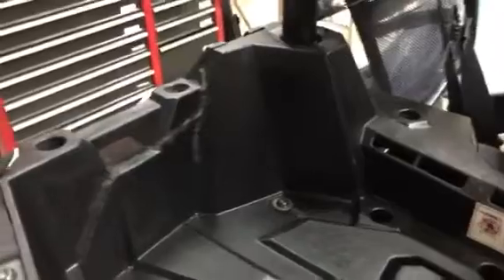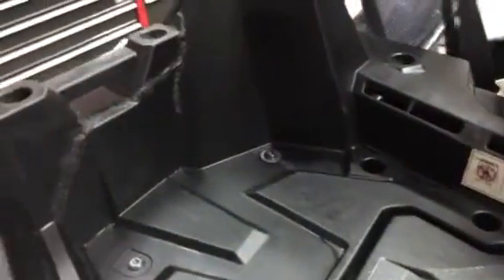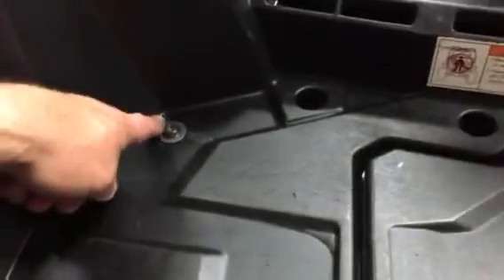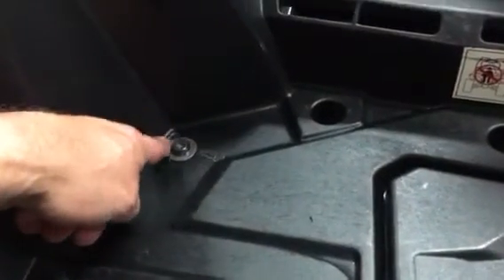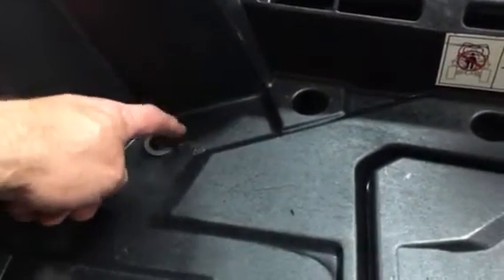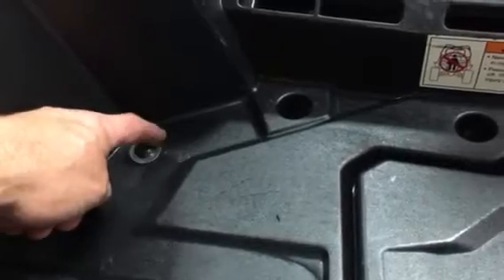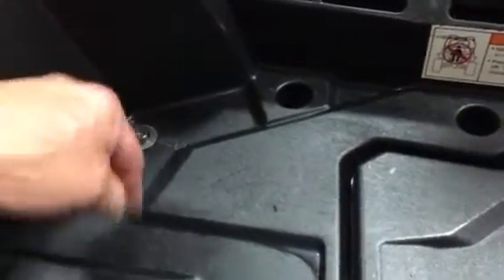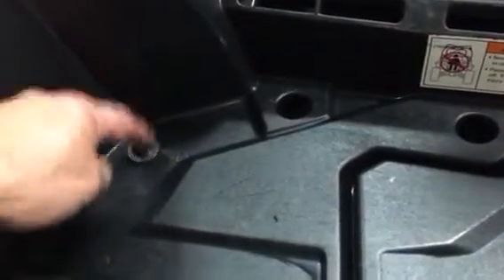I put the gray on the back side because I didn't care about the color, and the black on the front side. I also had a hole here where the bolt had pulled through. You can put tape on the back side, put the piece back in there, fill it with the powder, use the glue, keep building up and building up, then use a washer to reinforce it. I actually refabricated the hole that was there too.